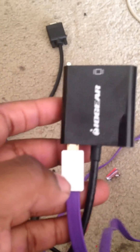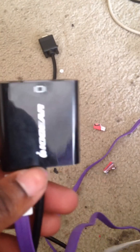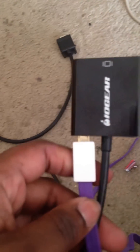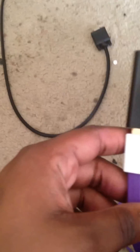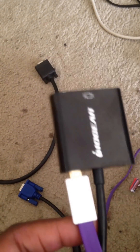You're also going to need an adapter. I got mine at my local Microcenter, and I've also put up links to Amazon. It needs to be powered, which is why this purple cord is here. If you want to try this with an Xbox 360, you don't need it powered because the USB ports supply enough power, but for the PS4 it doesn't. This particular HDMI-to-VGA adapter needs 5 volts to work. I tested it — it works fine.